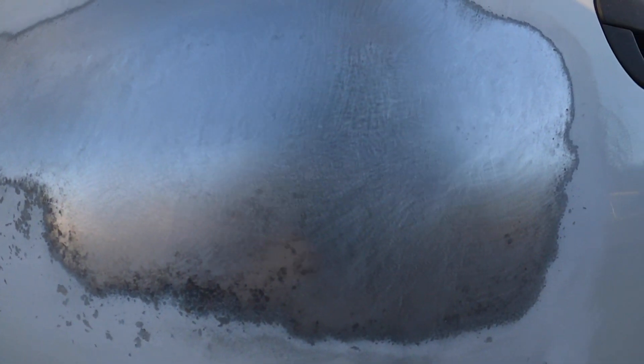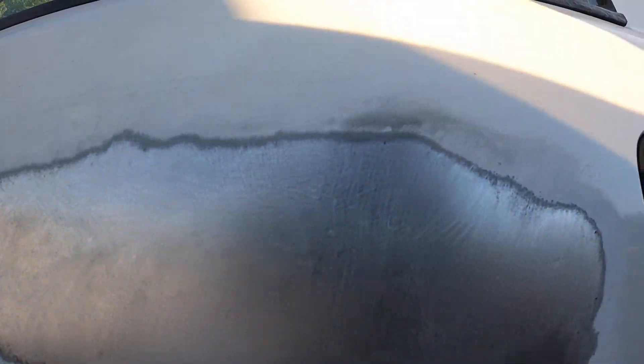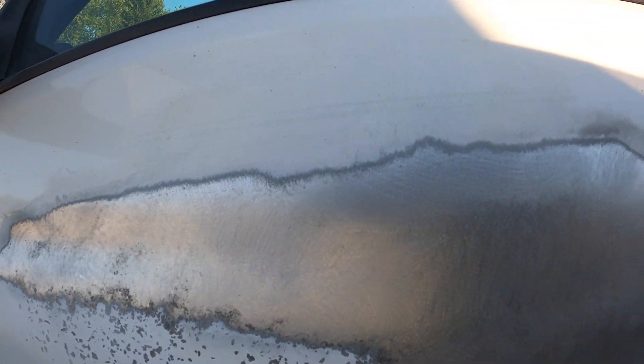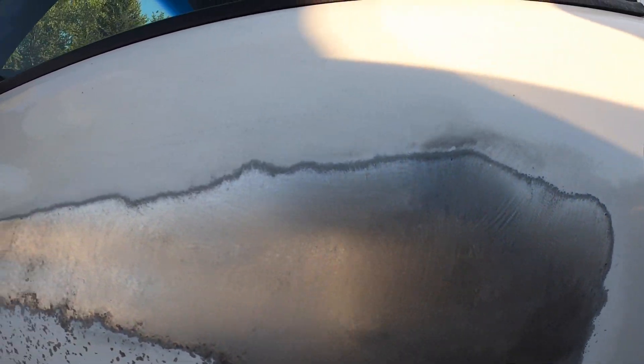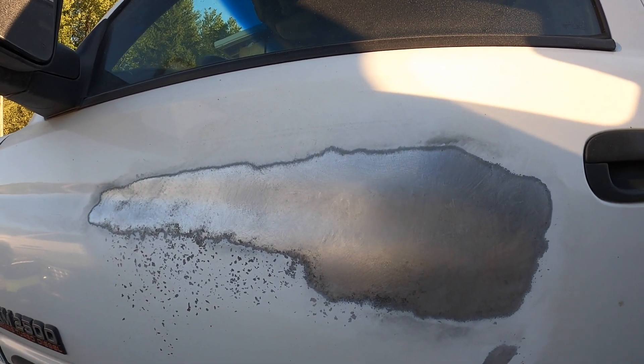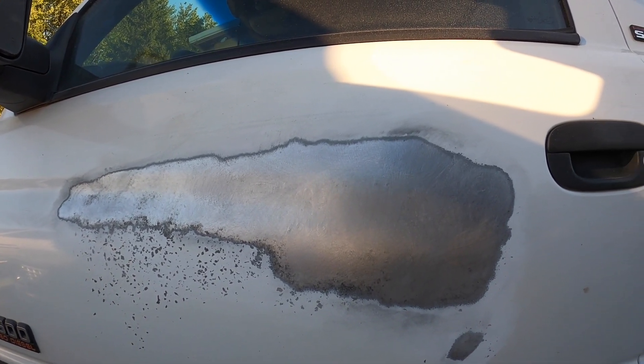You can see what's causing the bubbling, or what did cause it. I have it sanded down up here all the way to metal, but there are some — I don't know if they're rust pockets or what exactly — but that is what was causing the spider cracking. I have to get down to bare metal all the way around in this section to make sure that doesn't happen again for whoever ends up with this truck.